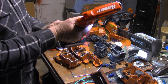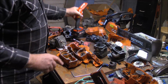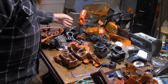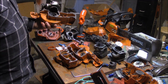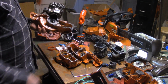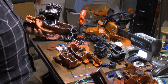What happened was either a part or a manufacturing problem created a situation where those bearings ran a little bit hot. And while the steel cage bearings could handle the heat, the nylon bearings couldn't. That's my theory. And the reason why they ran hot comes down to one or two or three different reasons. One is there might have been a misalignment from one bearing pocket to the other one. So that bearing was running at a little bit of an angle, and the side load made it run a little bit hotter.